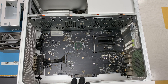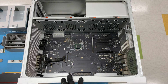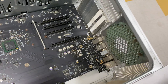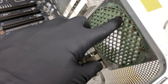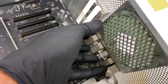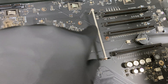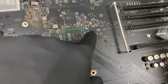This here is the early 2009 Mac Pro that's now having some issues with powering on. After some triage and an internal inspection, I found immediately where the issue was coming from. If you follow me right here, you can see that there is severe corrosion happening right here on the internal part of the enclosure. This is where one of the fans sits for ventilation into the system. And over here, you can see some rust happening with these internal screws here, here, and here, as well as on some of the transistors here and here.